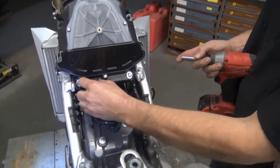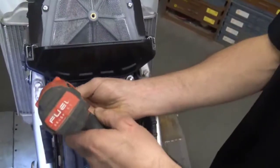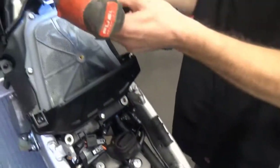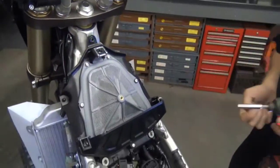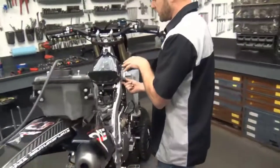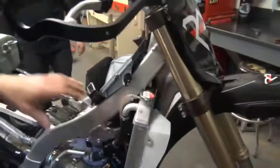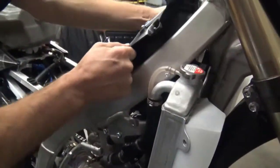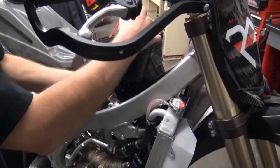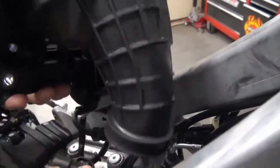Lift the connector off. There's 3 bolts on the top, 8mm socket. Once these 3 bolts are out, there's an intake air temperature sensor that's on the bottom side of this over here. You can't get to it until you start to lift this off, and you might have to work this a little bit because it's obviously still got a tight connection to the top of the throttle body. Alright, once all of our bolts are off, coil's disconnected, roll this out of the way. Intake air temp sensor right here. Push, pull.